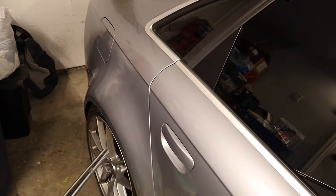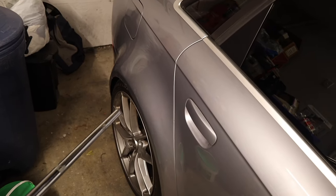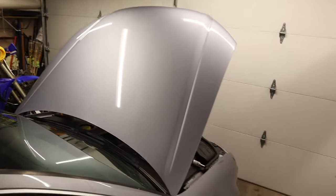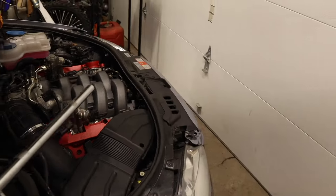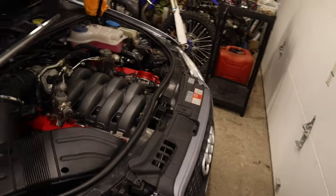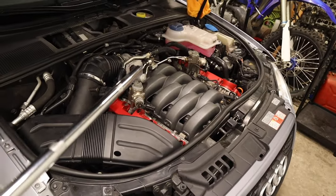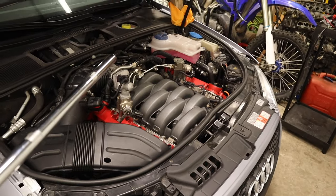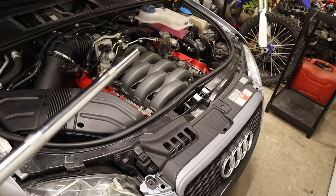Let's see what they put on that car, because that DRC system is going to fail and start leaking, and they won't find parts for it. All the hoarders on the forum have it. The big point with DRC: it's not even that if your shocks aren't leaking or if you can change the shocks — you need a specialized tool, high PSI, to refill the system. And anyone who's been under these and knows the truth about it: those accumulator valves in the back, and the lines and everything, really like to rust. If the car's been winter driven, those lines can also fail. It's just better off putting coilovers on these cars — it improves the handling. And this car is extremely comfortable.